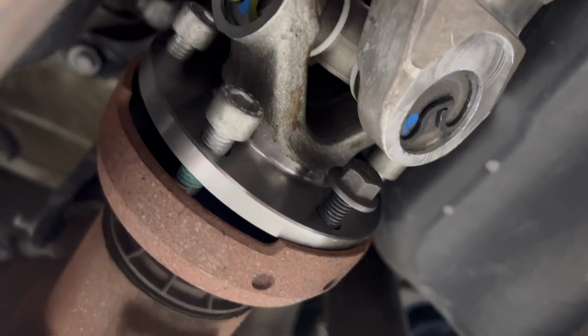So I went ahead and got some fresh Loctite, and these two put up in the top here. Went ahead and stretched it down. And then we did as the instruction said, got a pinion bolt right there. And on the top side, we have another one put in right there, just the way it aligns it. So we're gonna tighten this down, get this flat, and then we'll start putting these in and torquing it down to spec.